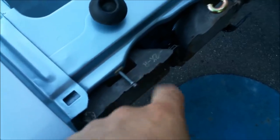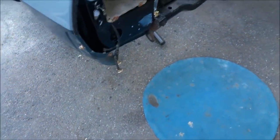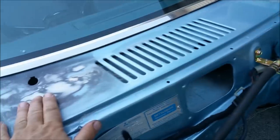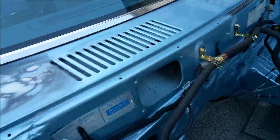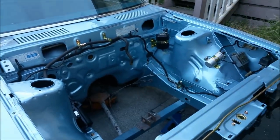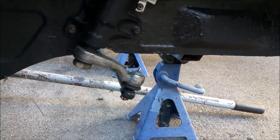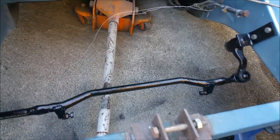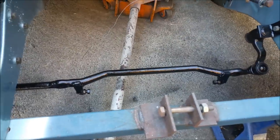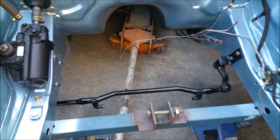Wiper motor can go in once I've painted that, then I can put the wiper swivel pivot things in, put that plate on there, washer jets, and all that sort of stuff. It's looking good - seems to be going as planned. I've been doing some body work and also re-fitted a drag link just to see how everything fits on there. Pitman arm is identical, I measured all that and had a look at it. You can see the drag link down there - I've just licked over it with black paint. That's only pinned in temporarily to check it's all parallel and working properly.